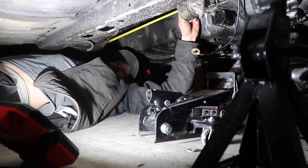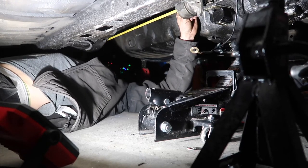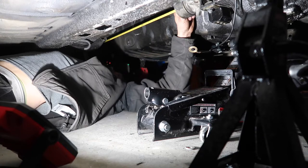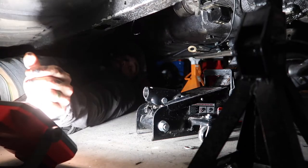Okay, so what we're measuring is from the face of the transmission output shaft to the face of the rear differential flange, which is 35 3/4. And then what's going to happen is when I give those measurements to the driveline guy, he knows the distance